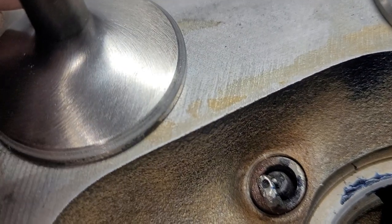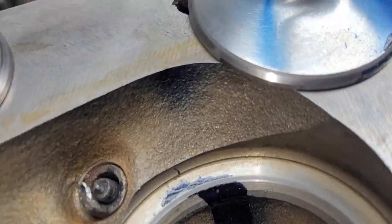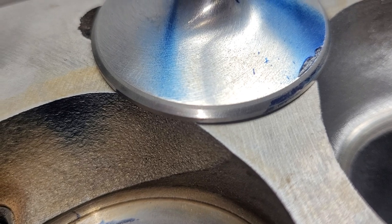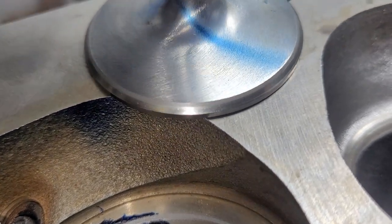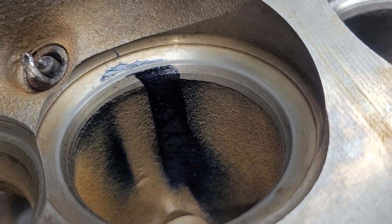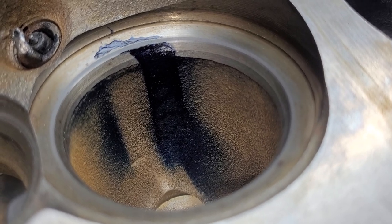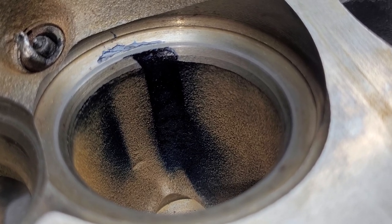It is quite a bit thicker than I probably would have run. I did this on the untouched ports and chambers. But this is what I had a feeling with the intake — see if you guys can see where that is. It's at the very very top of that valve. When you measure where it's touching that seat, it's 194, so we're getting 300-plus CFM basically through a more shrouded 194.